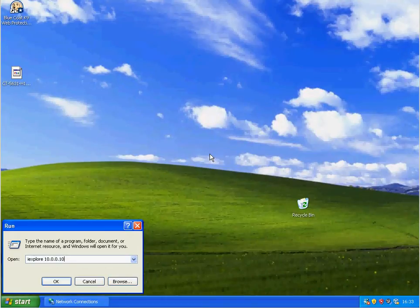This is a video of how to firmware upgrade the Comtrend Nexus Link 5631, which is used by BE as their line bonding router. Depending on the age of the router you've got, it will either be on 192.168.1.1, or the newer ones will be on 192.168.1.254.